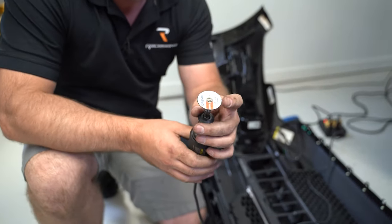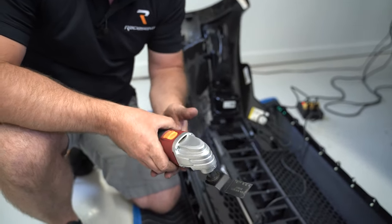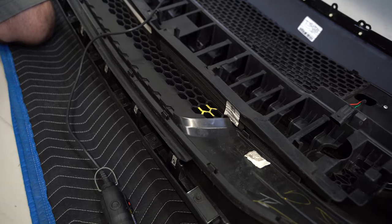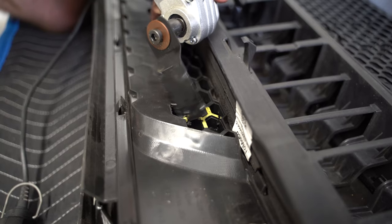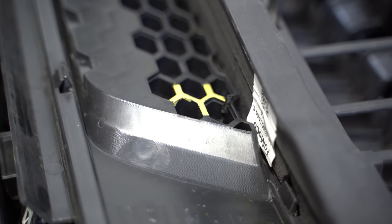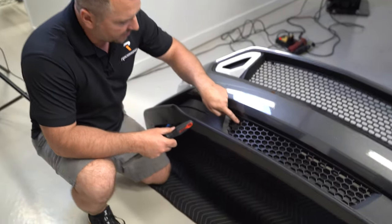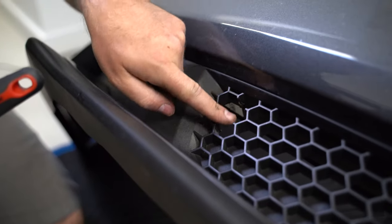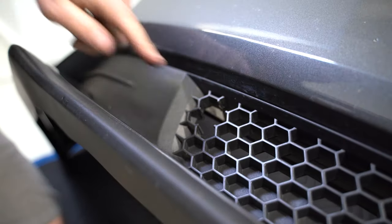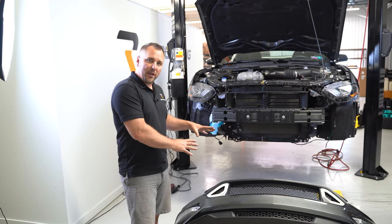Take the bumper off and use the yellow paint marker marks to map out the pieces of honeycomb to cut out, avoiding mistakes. Use a dremel with a reinforced metal blade or an oscillating saw to remove the bulk of the material, then file and hand sand for a clean finish. Intentionally stay inside your cut lines and come back with a file to get a really nice finished edge.